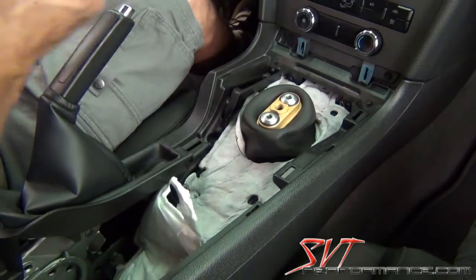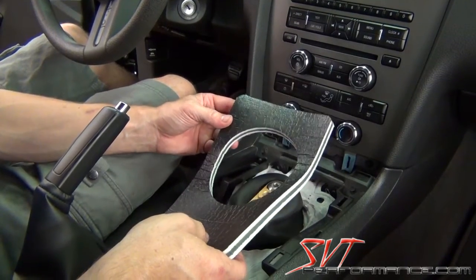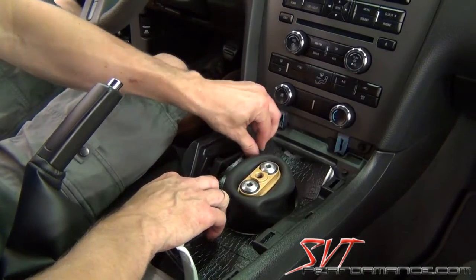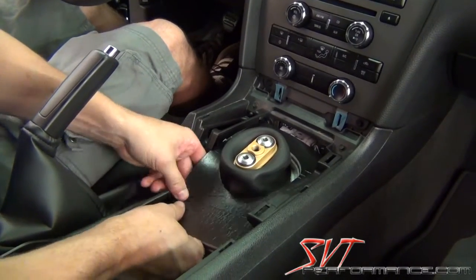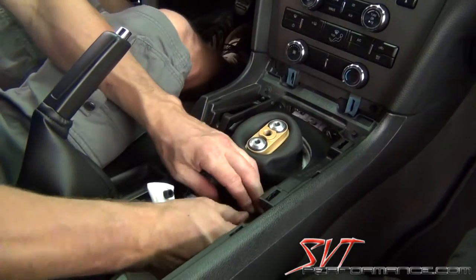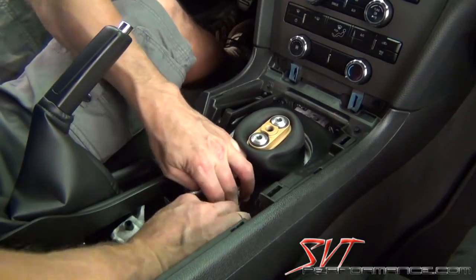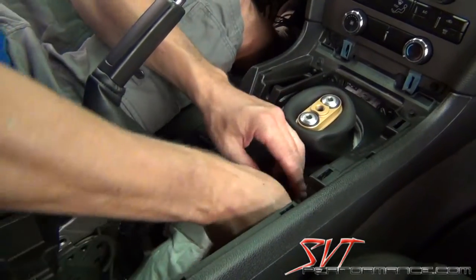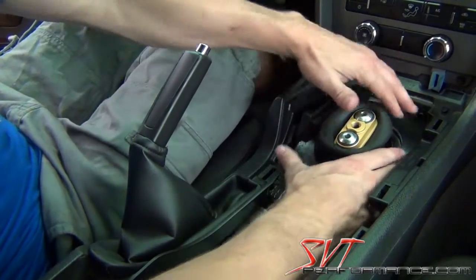And then MGW provides an additional thermal and sound barrier that actually has a leaded core, which gives a little bit more thermal and sound insulation than the factory provides. And that has an oval cutout that goes in just like that. And the rear of this pad actually has slits in it in the back that you'll push those studs that stick up through, just like that. And then this back piece with the little connector pushes onto that stud there. And that's all sealed up.